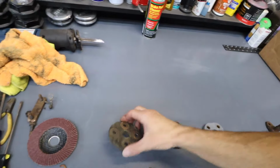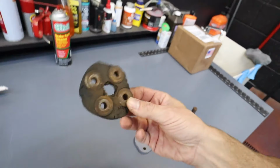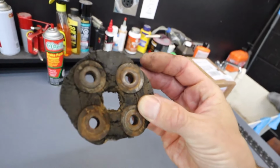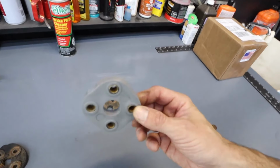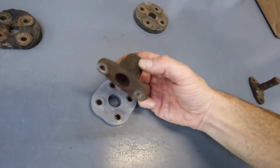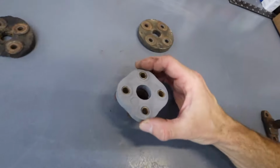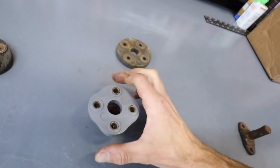So the rag joint, although it could be replaced, is still together. It doesn't look like the rag joint that came off of the Beetle pan that the car is sitting on. Look at that. But my friend Sam Bunker brought by a brand new rag joint, and those aren't even remotely close, right? So I used the new rag joint and the Auto Union flange. Same deal, not the same. It's off by half the distance of the hole, so it's obvious that it's not the same.